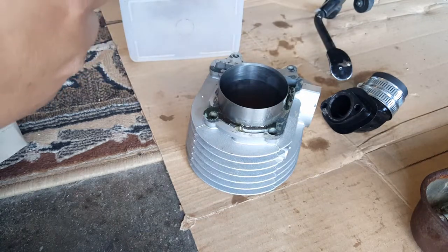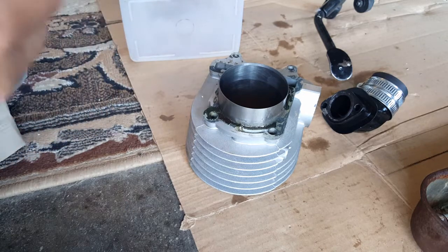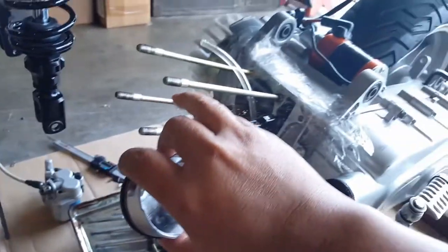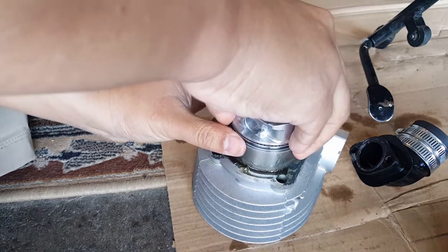Another thing also is the torque on the cylinder stud. I just want to make sure it's correct. It is 180 inch-pounds. Okay, not 185, 180 inch-pounds. Just want to verify that. So when you torque this stud down here with the rocker arm assembly, torque it to 180 inch-pounds, not 185. I guess it does matter just a little bit slightly. So just want to clarify that. Let's see if I can get in here now.